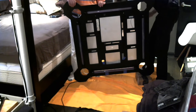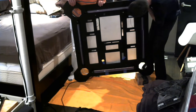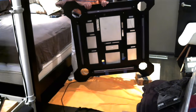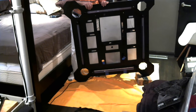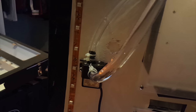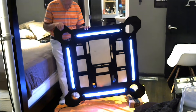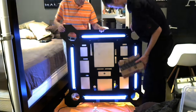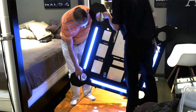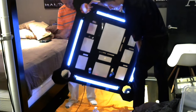Now, we had done a leak test in the garage before filling the loop with the mineral oil, using water. This is recommended because we didn't want to have to deal with a leak after the fact. Be sure that you have liquid in your pump before trying to turn it on. A liquid pump must be primed in order for it to actually work. So in order to prime our pump, we had to get all the liquid into all parts of the tubing. So we had to flip it and turn it a bit. But once the oil was evenly dispersed, the loop worked fantastically.